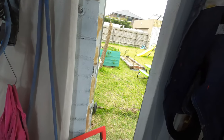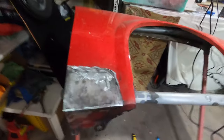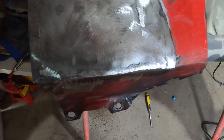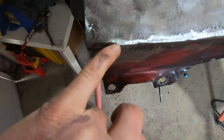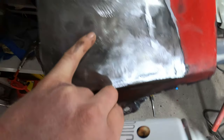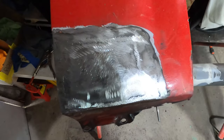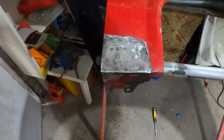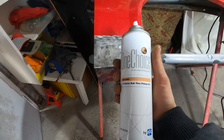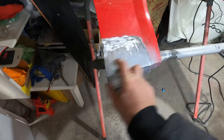I cracked the door open a little bit when I was doing my welding because there was a bit of smoke coming out. It's good to have a little ventilation when you're doing that. That patch is looking pretty neat. The welds weren't the absolute best, but they had good penetration - I haven't got any gaps in there, no holes that air and water are going to get through later on. I'm actually quite happy with that. That's a pretty good welder.